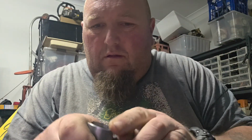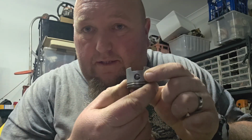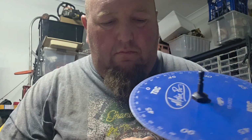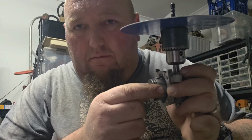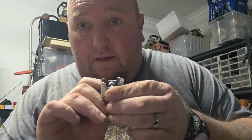Piston was flat all the way around. Now it's got windows in it because at bottom dead center it closes the transfers, so now they can. There's a method to the madness. I did watch Charles Briscoe do the same thing, but I don't know if he went as high as I did.